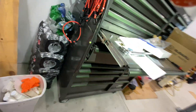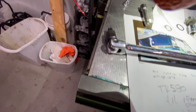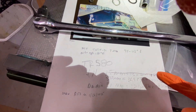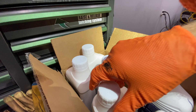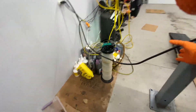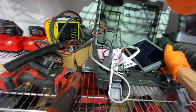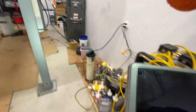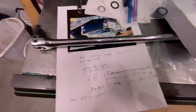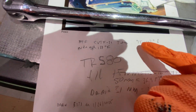So here we have the old one, and here's the new one. The fill plug is 50 newton meters, 36.9 foot-pounds. Just to review what I'm going to do: I will take three and a half quarts because I already know from previous measurements that's how much came out. I will put it in the fill hole using a pump, then gently close the fill hole. I will start the car up and then use my scanner to measure the automatic transmission fluid temperature. The CVT-F-2 wants to be between 95 and 113 degrees Fahrenheit.